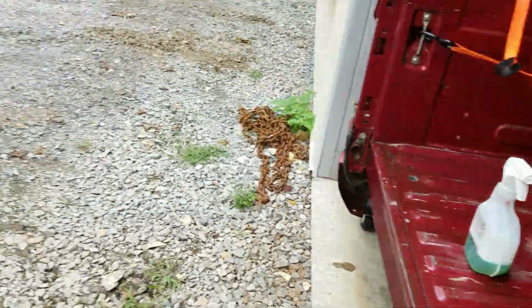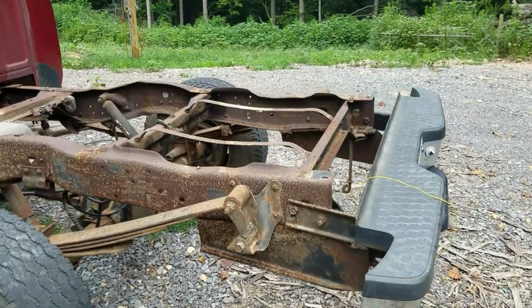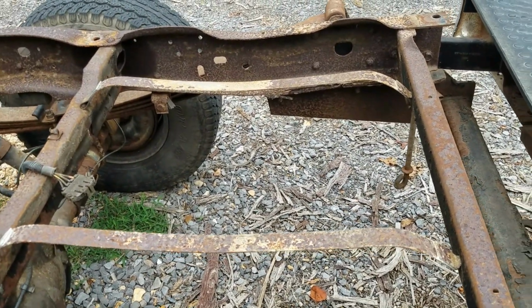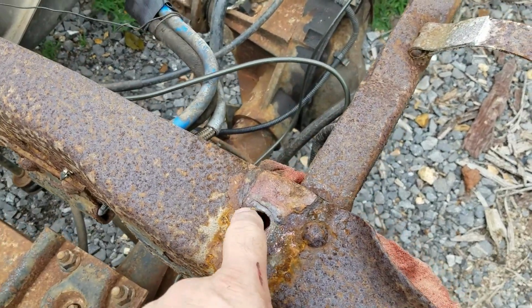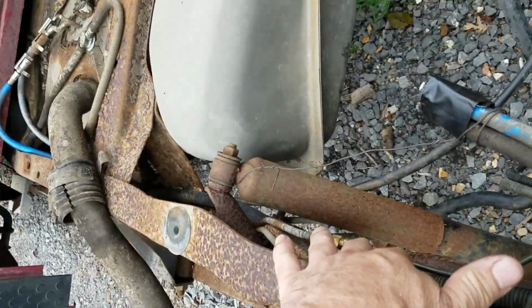And we had to get out the, I'll show you, the truck frame's rusted pretty badly. Another reason it was such a bear to get out was the back fuel tank, which is supposed to be here, which is going to get deleted, was leaking badly. There was gasoline everywhere. This is where the bolts were. And eventually I had to get a torch up in here. I ended up cutting the fuel lines. We're going to have to get a bypass kit.